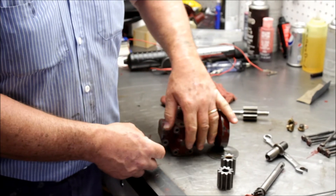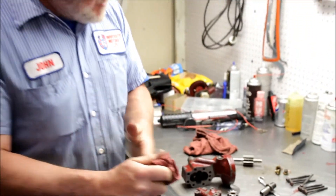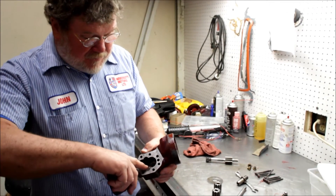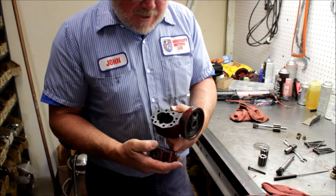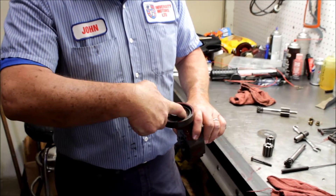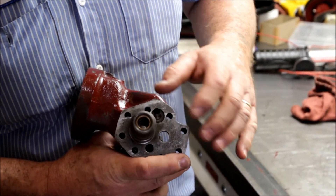So this is a quick examination of this XPAG oil pump. Again, there are two styles: the kind that carries the vertical filter and this style that carries the horizontal filter. All the oil that's made is pulled up from the outside, washed up to the top where it's made available here, then goes through some cross drillings and is available through this quarter-inch hole only. That goes underneath, comes out underneath the filter, washes around the outside of the filter, down the inside, and then finally is available up here to go back into the block.